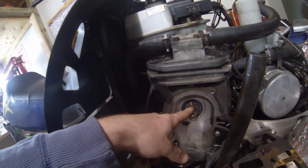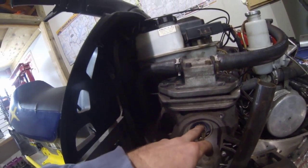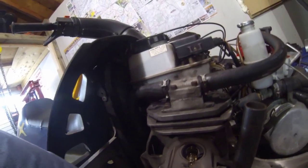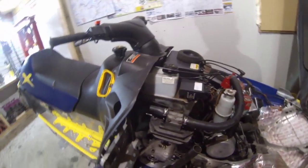Put the brake on and twist that nut off. There will be a washer behind the nut — take that off with it. There will be a gear — slip the gear and chain off. And then behind the gear there will be a little spacer. Once you have that all off, I'll show you.